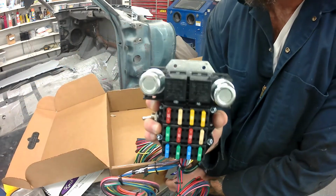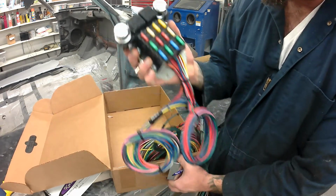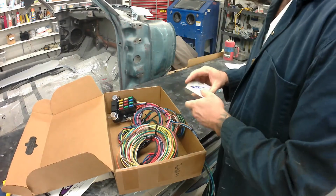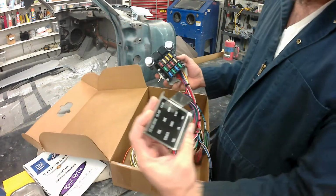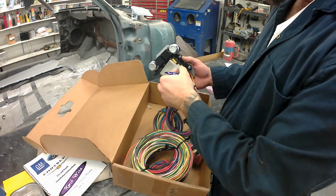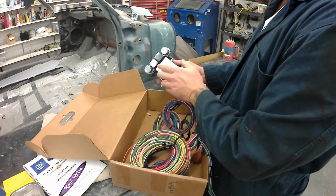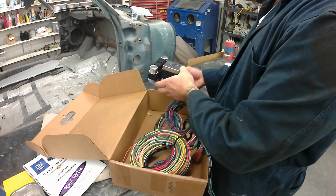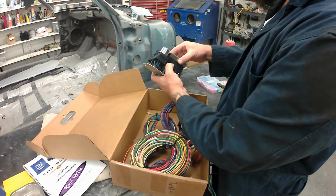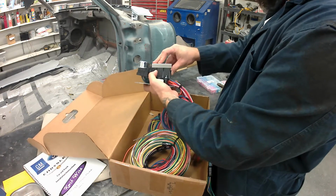I always change those flashers out to an LED capable flasher. If you go all LED in the car and don't, your turn signals and things won't work. So it's not your wiring, it's that relay. It needs a certain amount of wattage pulled through it to store up that capacitance and hit those flasher signals. So I think we'll wrap up the little box demo here, and if I can put this damn cover back on this thing, we'll start going through.